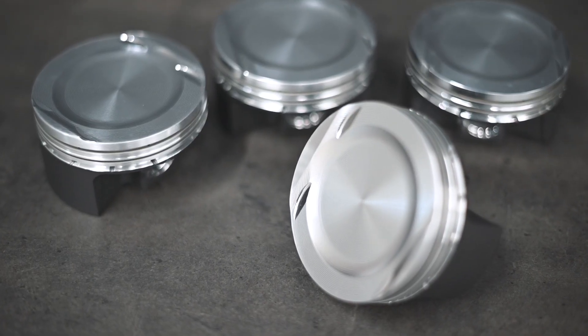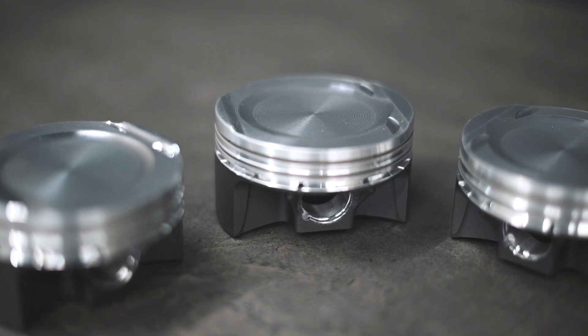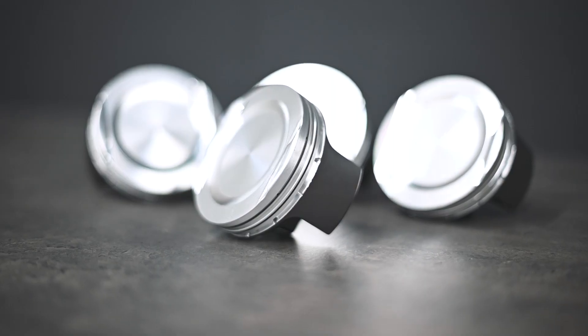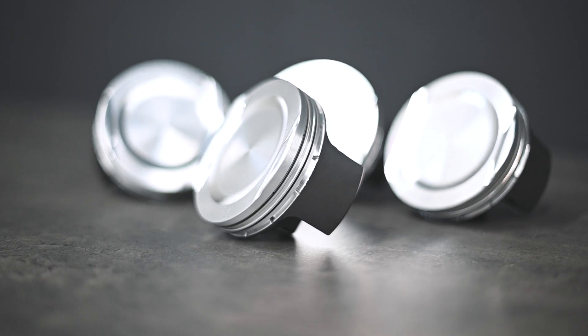The piston diameter is identical across both engines, with design tweaks like pin height and dish to account for the 4L's longer stroke. While the OE pistons are reliable enough for certain builds, our larger builds utilize CSO-spec pistons crafted with top-tier aftermarket manufacturers for enhanced strength and performance.